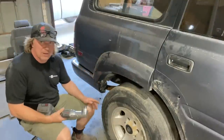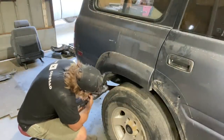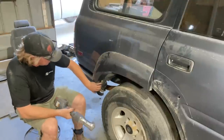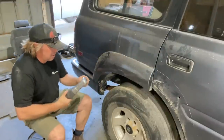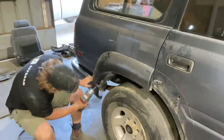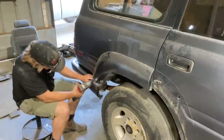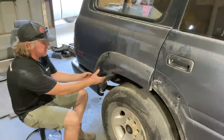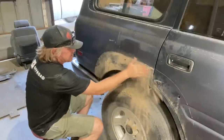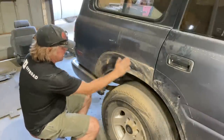I'm gonna remove the rear bumper cover right now because that's gonna end up leaving this project and getting replaced with something new. So this you can kind of unscrew. There's three little screws that hold the front of that in. And then we're just gonna throw this in here and remove a 10 millimeter bolt that's hidden by the bumper cover. And once that is out, this flare will fall right off. Not a bunch of dirt and dust, but luckily there's not any rust hidden back there.